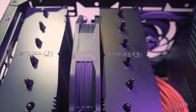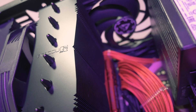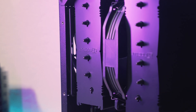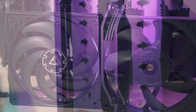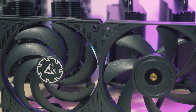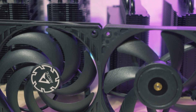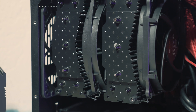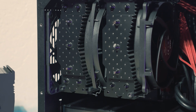I also took advantage of this opportunity to try out the new slim Arctic P12 as a case fan, and it performed very well — practically silent. The D15S, in contrast to the Dark Rock Pro 4, mounts up very easily; just two screws tightened down and then you slip the middle fan in. Because of the single fan configuration of the D15S, I kept the rear 120mm NF-A12x15 on the same fan header as the middle A14 fan, so it spun up a little faster at around 1100 RPM while the A14 fan ran at roughly 850 RPM. The Dark Rock Pro fans are very quiet, and since it was a dual fan configuration, I dialed down the rear case fan to about 800 RPM to give noise headroom for those cooler fans running at about 1150 RPM. Set up this way, these two configurations came in at equivalent noise levels, and along with the RTX 3070 FE running at 50% fans, noise was only 3.5 decibels higher than the noise floor.